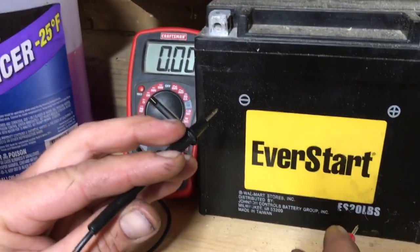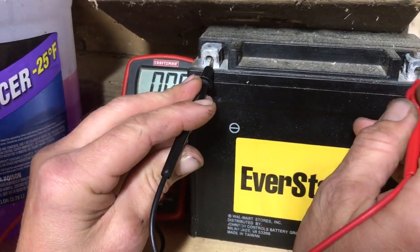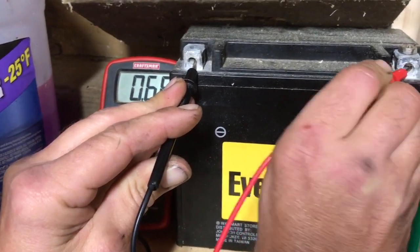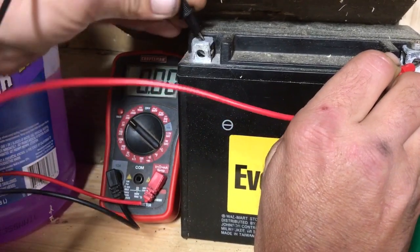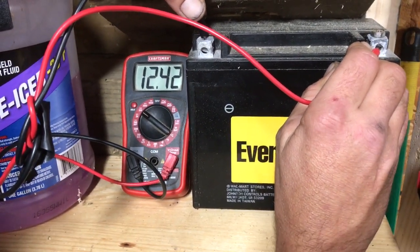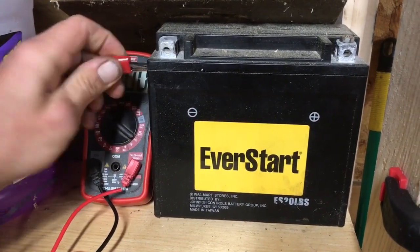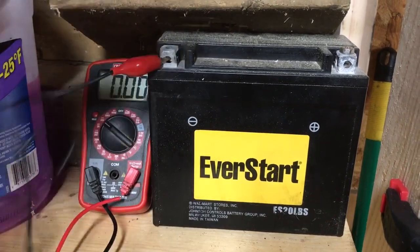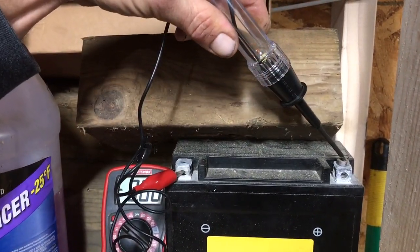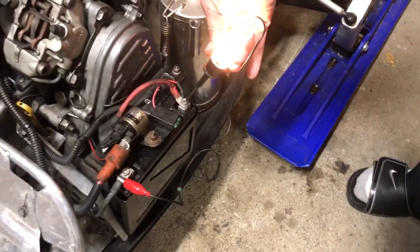Here's the old battery, untouched from last year, about December. We charged it — I don't know what's wrong with it, we're not getting a good ground. It says 12.42. Okay, we got 12.42 sitting in the battery. You pull that off, take your old trusty test light, go ahead and clip her on ground — nothing. It goes right to nothing, won't even power a light. Now you come over here to the new battery — night and day. There's your problem.